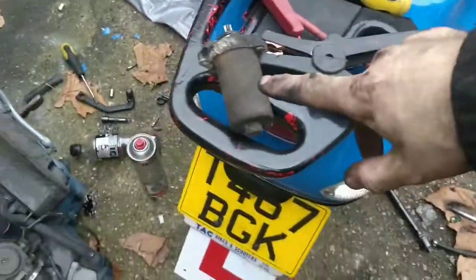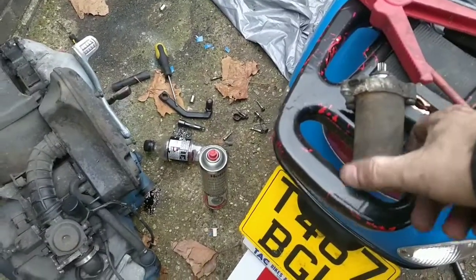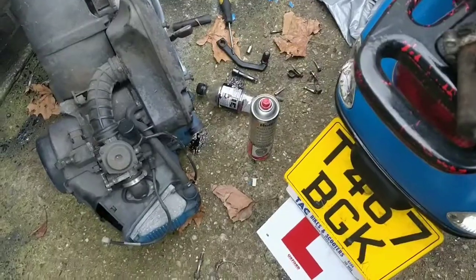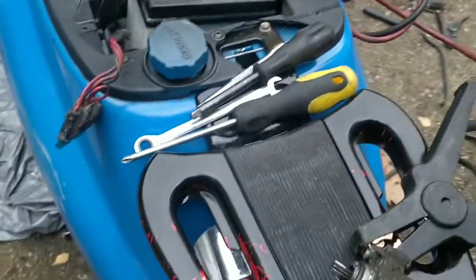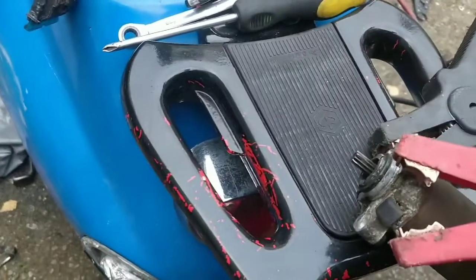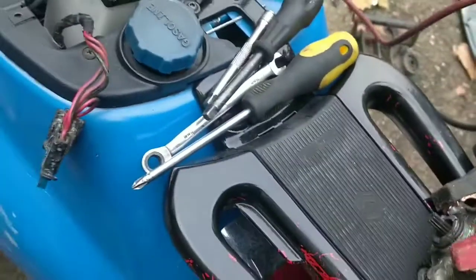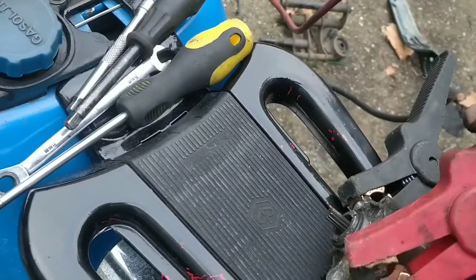So guys, you can bench test your starting motor. You hook up the earth somewhere. And then you hook up the power. On this occasion, there is an actual power cord and it's under here and it's snapped. So touching the power to in there should fire us up. Right, watch, you ready? Oh, there you go. See it spinning? Right, let's show you again. Touch in there. Come on. There you go. You just need to make a good connection, guys, and leave it there. But look, it will spin. See it spinning? Come on, get in.